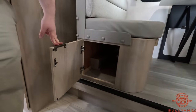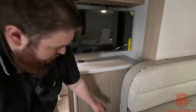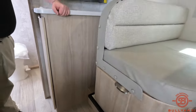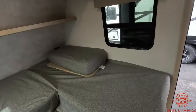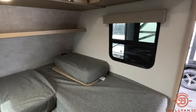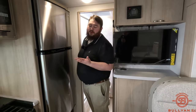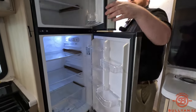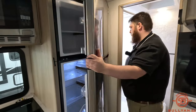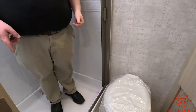You get storage underneath both sides of the dinette, a TV right here with a wireless phone charger. These outlets with yellow stickers are going to be all around the camper — by the door, both of the ones up by the bed. If you decide to install the solar inverter, which we can do for you here, those outlets will run off your batteries. One thing to note: whatever you're using, make sure it's 12-volt compatible, not just a regular 110 system.